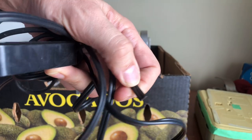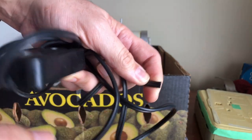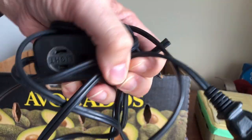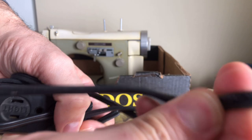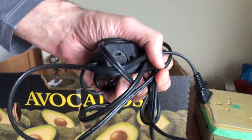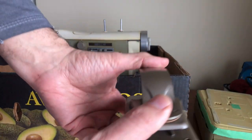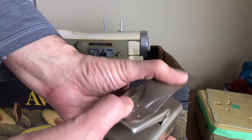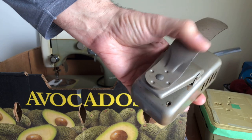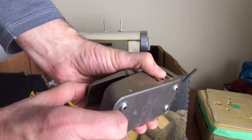I did an earlier video where I showed you guys the foot controller on this machine. It was broken — unfortunately the porcelain was cracked — and I'm not going to use any foot pedal that is compromised. The cord is still supple, there's no cracking or dry rotting, so I will test it and if it functions with the electrical contacts we're going to keep this cord and reuse it with another foot pedal. This is a carbon pile vintage pedal and I'll test it and see.